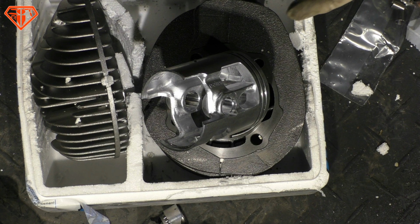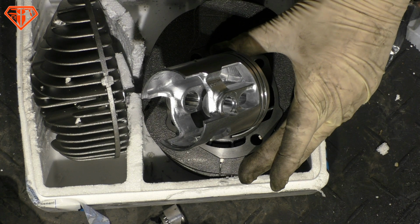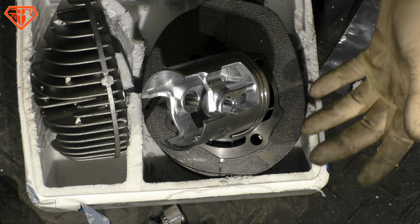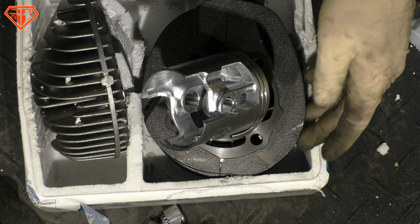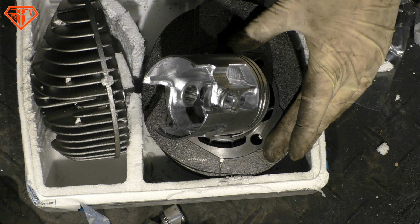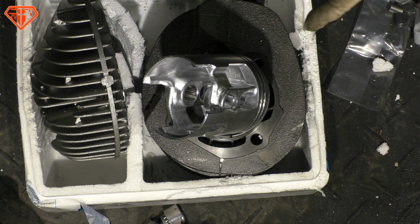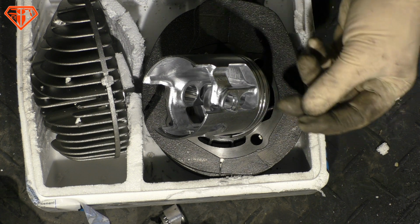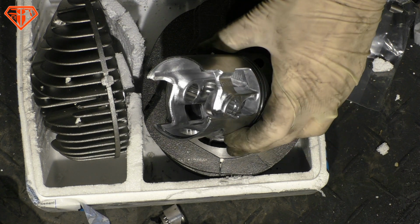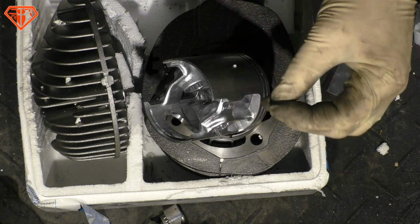And which gearcock would you take? It does rev more. You can even go from a standard 23 teeth clutch gearcock down to a 22, because we know that the fourth gear is anyway not really pulling so well on an original engine. Please set the ignition timing in detail, give it 19 degrees, and you're good. What happens if you do not widen the main jet bore: any main jet above 125 will not work properly anymore because it's not going to be fed 100%. So you can use a 130, but it won't be a 130 because it does not get enough fuel.